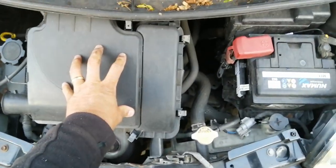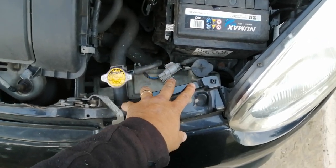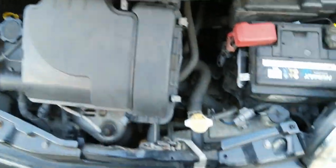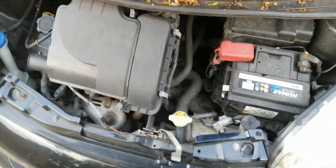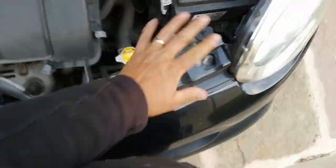Generally if you're running low on water the car will smell hot, you'll see your temperature indicator rising inside the car. Another possible symptom is that the cooling fan inside the heater is blowing cold or lukewarm - you can't get hot air blowing. So that's the water.